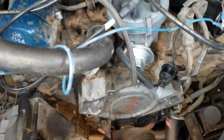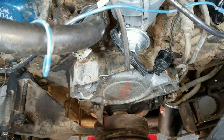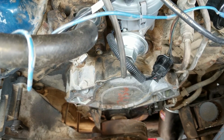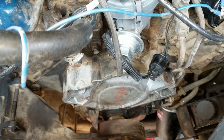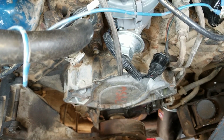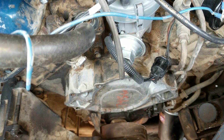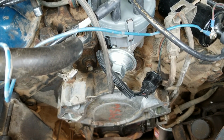partly. And I got my drive shaft. It's got a big dent in it. I'm going to be taking that in, having that done professionally. Just have basically a new one made using the ends of the old one, and they're gonna balance it. Then I'll install it. I had a vibration in the back, and I suspected that was the problem, rather than the tires. Tires are new, but they do have a tendency to have a flat spot when they sit for a while. And since these tires aren't radial, they're maybe a little bit more prone to doing that, but they do even themselves out as you drive a short distance.